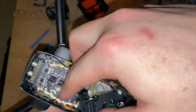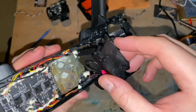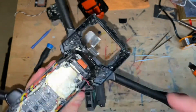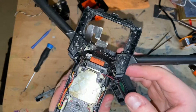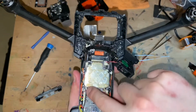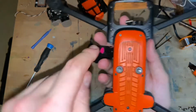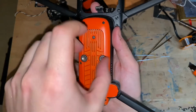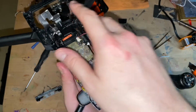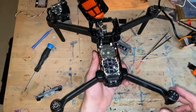So the fan, let me see how to disconnect the fan. The fan is actually hardwired, so you can't really disconnect it. Again, what I need right now is this arm. And to get to this arm, unfortunately, if you remember from my previous videos, removing it is the easy part. I have to desolder 6 wires, that's one, and then I have to lift this board up, remove the bottom one, unscrew the bottom part of the main board, and disconnect the antenna for this thing and sort of get the antenna out like this. But right now I need to go do some business.